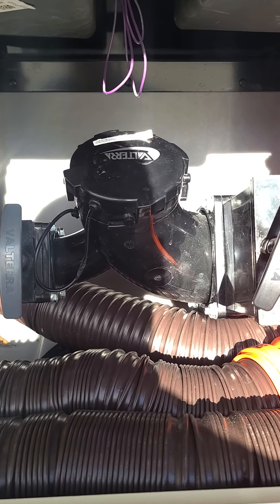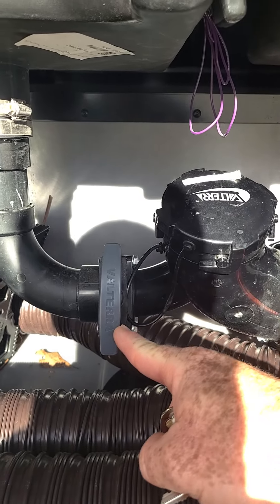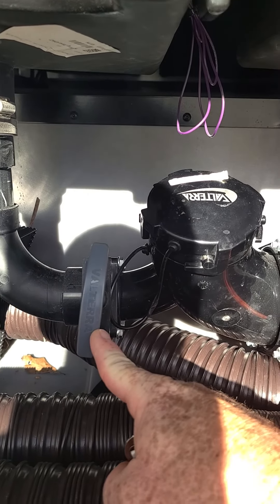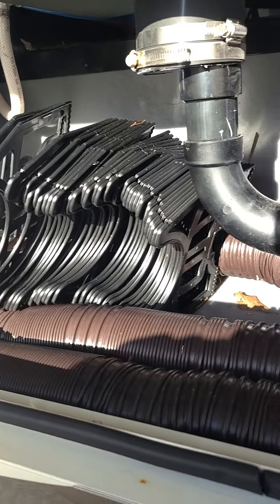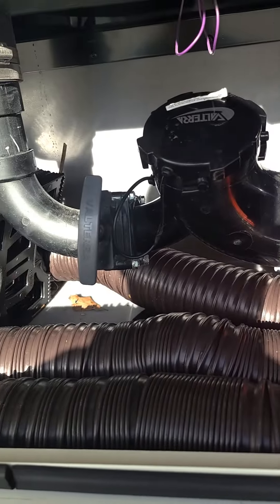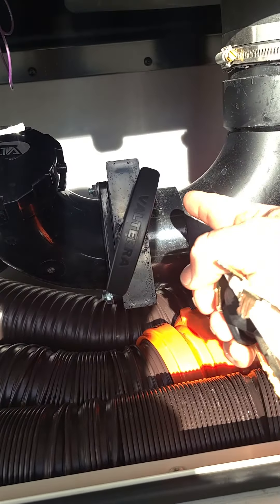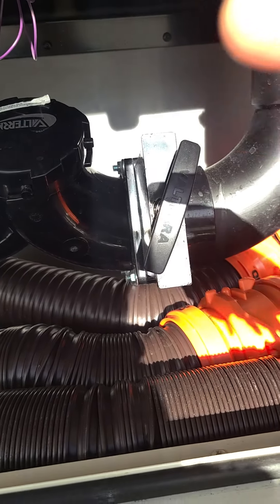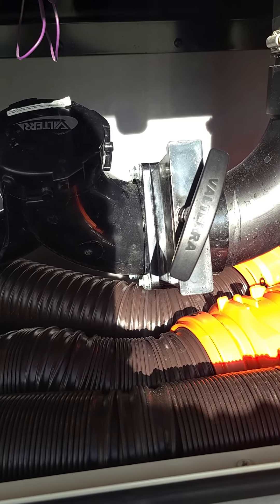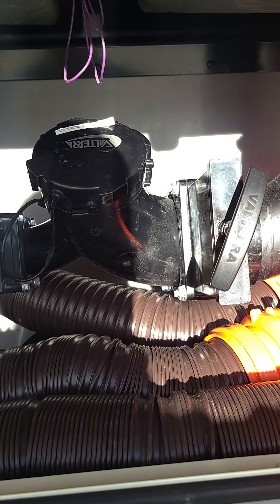Use your tanks as you need, and then when you come to dump, you want to run a little bit of gray water first to get the water flowing through your hose — which is on the ground or connected with a stand to keep an angle. Close that gray water valve, then open your black tank valve all the way out. It's gonna come out about six inches and you're gonna let all the black tank empty until there's nothing coming out.